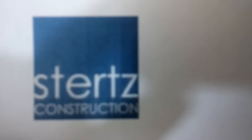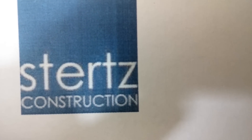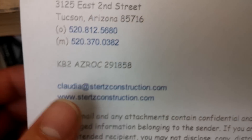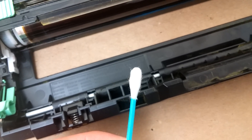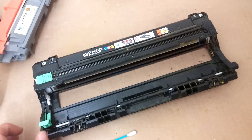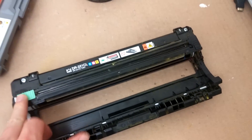So it just kind of looks like maybe the resolution is down-tuned on your image. For instance — I don't know if you can see this — it's not perfectly clear, it's got some fuzziness to it. You'll start to see it in other places. And what you can do is manually clean that with a Q-tip. My suggestion is this is probably your last resort, as you could damage or destroy your drum.